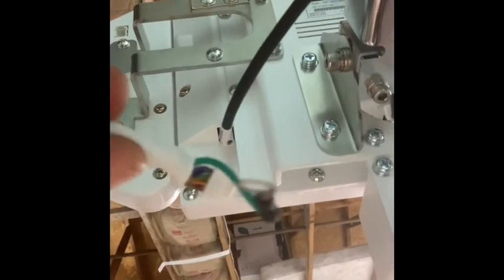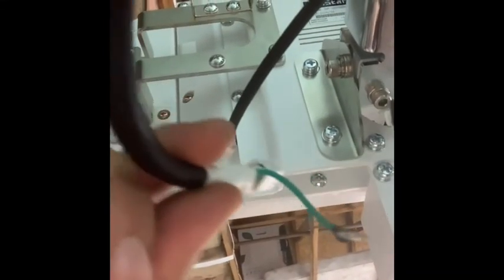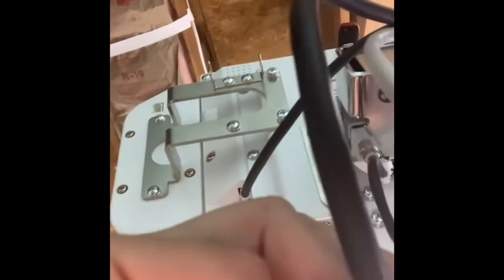Earlier when I mounted it, I already connected the monitor onto the bar. Now there are three other wires inside a plastic sleeve. You need to cut it open. The smaller black wire goes on the bottom area you connected. There's an Ethernet type connector. You put it where the red arrow is in the center of the mount. And then the larger black one goes on the left side of the monitor on the top area.